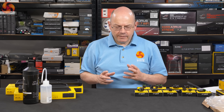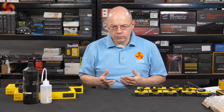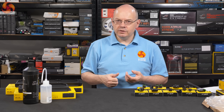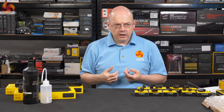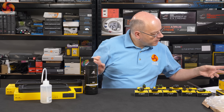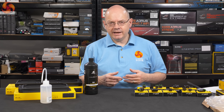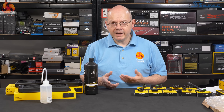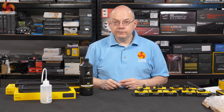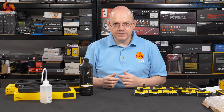We are assured it's not just a question of using the entire Corsair system for it to work beautifully together. Corsair also tells us that if you mix and match hardware from other manufacturers you'll be fine too. Essentially, if your coolant is good to use — pointing at Aqua Computer, Heat Killer from Watercool.de, or EK — you're good. So even though Corsair has supplied us with clear coolant, and they have some colours coming — green, red, blue, and purple — these will be clear colours rather than pastel. Their blocks are fine with pastels too; the thin pitch of the heat exchangers around 0.2 to 0.25mm won't get clogged, provided you're using good quality kit elsewhere in your loop.